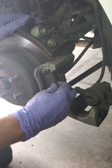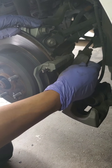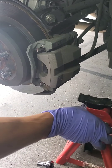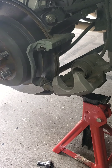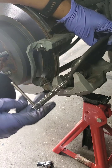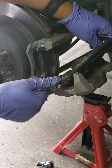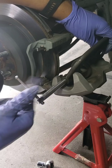Remove the old ones — should slide right out, like so. You can definitely see the difference in the new ones to the old, the thickness. I'm going to use a C-clamp and decompress the caliper so that we can get the new pads back on. Otherwise they won't fit. All the way in.